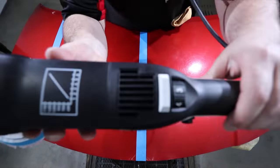Thirdly, to the Rupes rotary pads. I'll start by saying that the ultra fine white and fine yellow pads are probably now two of my favourite finishing rotary pads. They are honestly fantastic pads that even after testing it on some super soft paints, they seem to finish about as good as any pad I tried. Now, I don't mind the blue foam pad, but since using the Rupes yellow and blue wool pads, which seem to noticeably cut more and also finish better in many cases, I just don't really see a place for more aggressive foam pads in general these days.